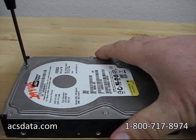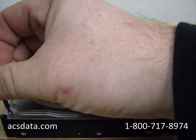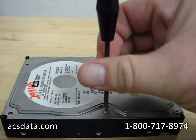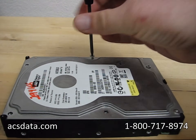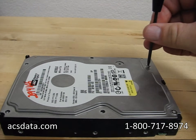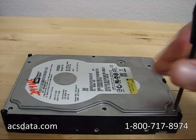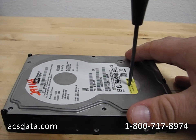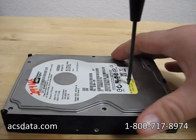I'm going to go ahead and open this up. There are a couple of issues that come into play with drives that have been in the freezer. First of all, there are the ice crystals that start to form on the platter — that's a death sentence for the data right there for sure. But even if it didn't get quite cold enough for full ice crystals, you still have condensation buildup on the platter, which is also no good.